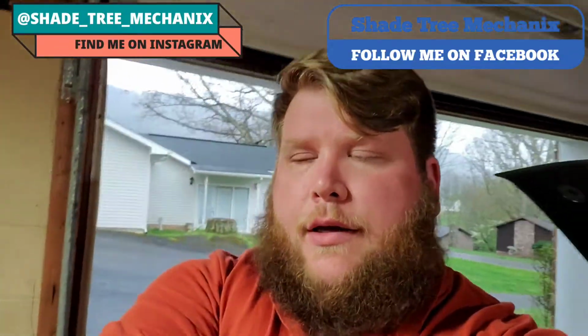I wanted to give you guys an update. A couple videos back, I showed y'all the Mr. Gasket Universal Throttle Cable kit that I bought, and I was super happy with it. Had it installed, it looked pretty, and then I went to try to use it. If you follow me on social media, Instagram, Facebook, you saw that I was not happy, because the very first time I went to crank the vehicle, I hit the throttle pedal and the ball on the end of the cable pulled through the plastic ferrule or grommet, whatever you want to call it, that connects to the throttle pedal, pretty much making the entire kit useless.